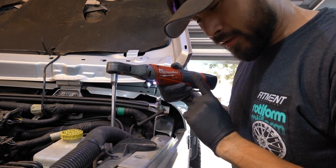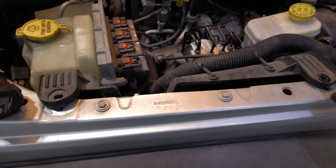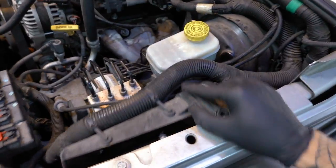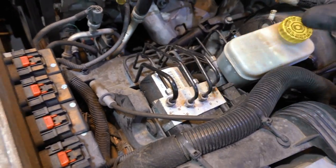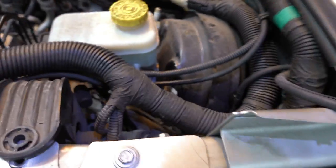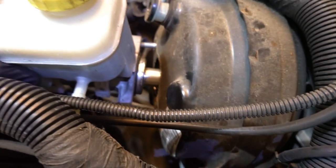If you want a really nice electric ratchet, these Milwaukees are the best. I've got a couple of 10 millimeter bolts that hold this whole tray - it holds the washer bottle, the computer, and the ABS module. I just need some more wiggle room to be able to move these lines. You can't just take the ABS module off the tray - there's a bolt on the side that's a 10 millimeter and one underneath. Instead of doing all that, you can just get all the ones on the top. Then you can grab the master and start wiggling it off, and you can see what we're working with here.